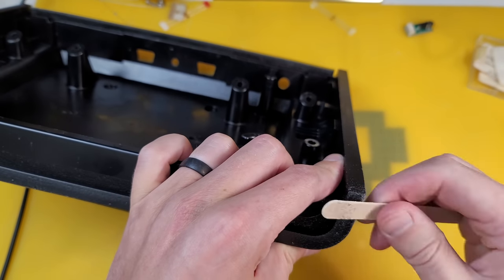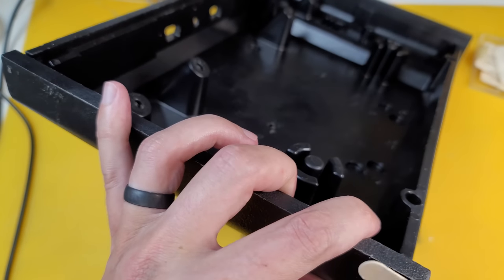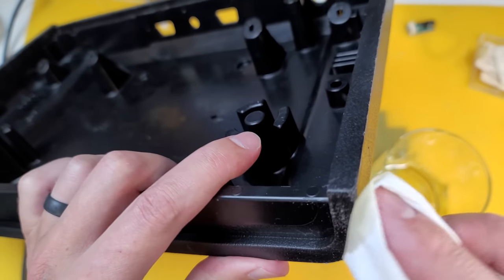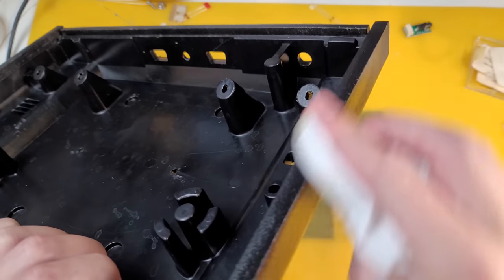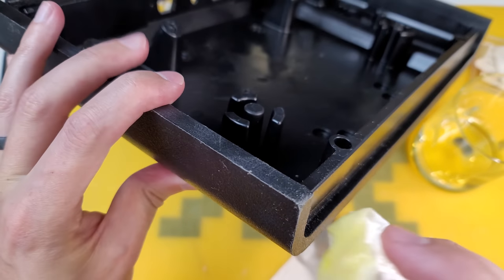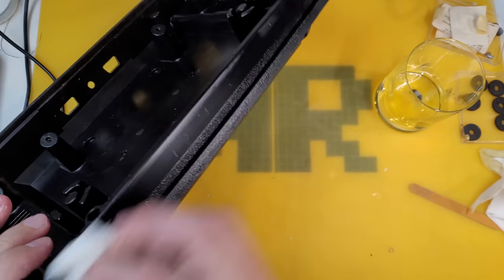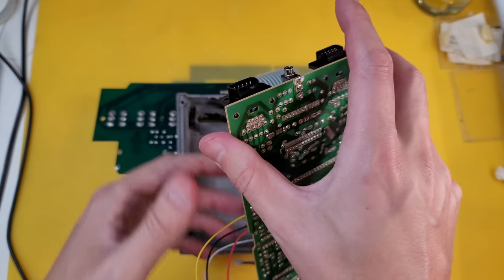Now, it's fine to sand that down because it is solid black plastic through and through, but to make it look brand new black, you could use that car silicone stuff that you spray onto dashboards. As you know, it leaves a bit of an oil-like slick, but I actually prefer to use good old extra virgin olive oil. This may sound crazy, and obviously it's up to you what you use, but this stuff does the same job, and because plastic is porous, I believe it also helps condition the plastic and just keep things a little stronger and less brittle than they might be otherwise. And of course, it's all natural and smells delicious. Oh, this is retro recipes after all.